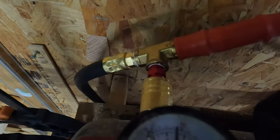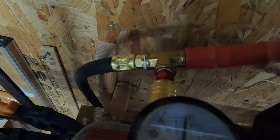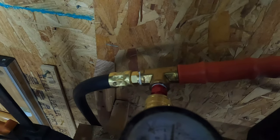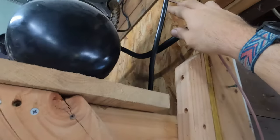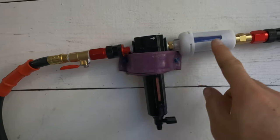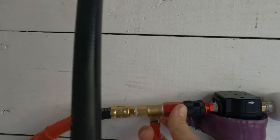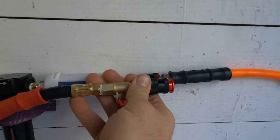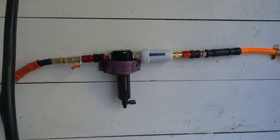I did that through a T-fitting on one of my air compressors so both of these feed into the same line. I set the regulator pressure at 45 PSI for the spray gun for both compressors. That's really important because otherwise you pump the other's tank up and let it out of the regulator. Both compressors lead into the T-joint up here, and I fed that into this black line which I quickly stapled to the wall and brought out to the front for easy access. The first thing I have is a shut-off valve, then a particle filter which also acts as an air dryer, and then a one-time use tiny filter — about $2.99. There's a quick-release fitting so I can disconnect these and connect it for regular air use like tires, or just plug it in for painting.